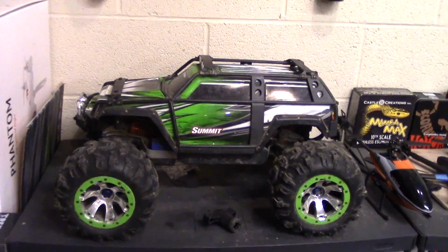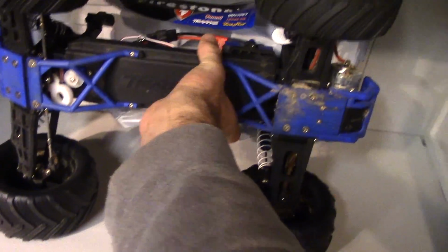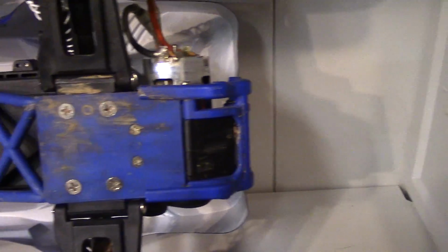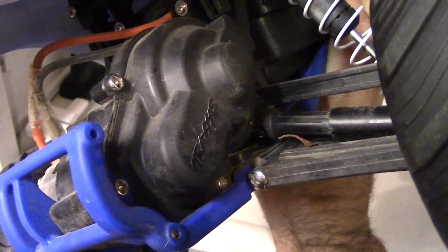It's staying brushed. So anyway, guys, same thing with something like the Bigfoot. This one doesn't have a lot of bolts like the buggy style, but you can check all your ones back here, your pinion gear, which is back here. Unfortunately, you got to take off the cover on this one to get to your pinion, which is only 2-3 screws to take out to access that.